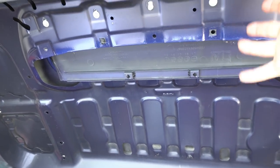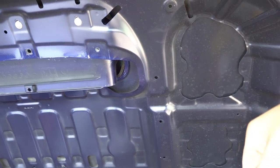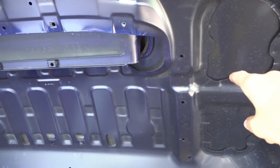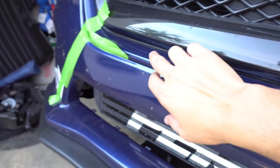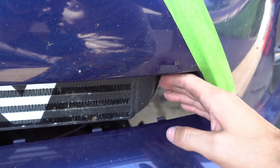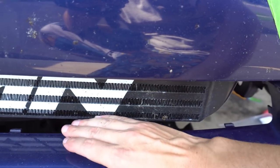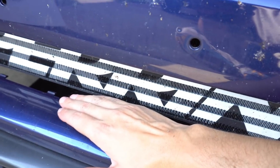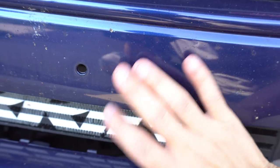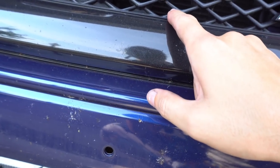I can't just delete the hood scoop, but I'm probably going to buy some hood vents and put those on there too. Right now I'm going to cut the bumper opening. I have an X-Acto knife and I'm going to cut through the line all the way to the top. I have some aluminum composite coming — I want to block off the sides here and force all the air to go straight into the intercooler, so no air goes through the sides and every bit of trapped air goes through to the radiator.